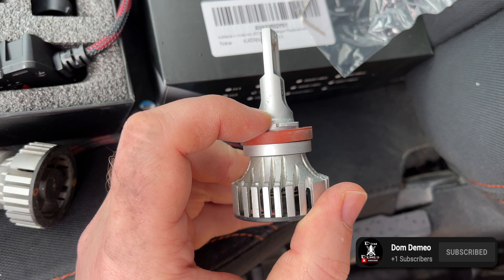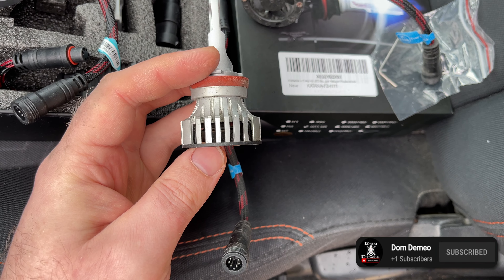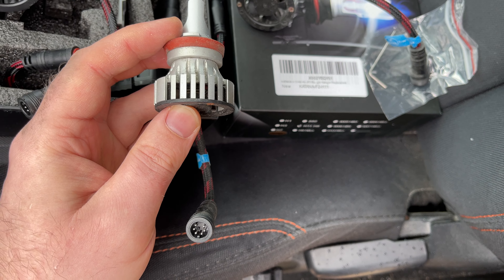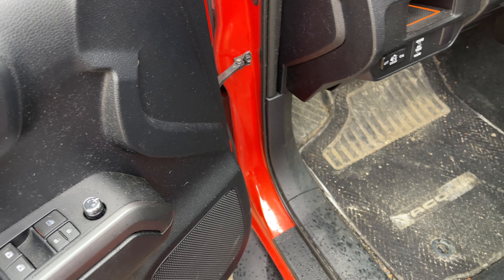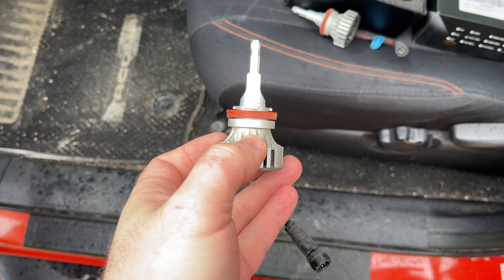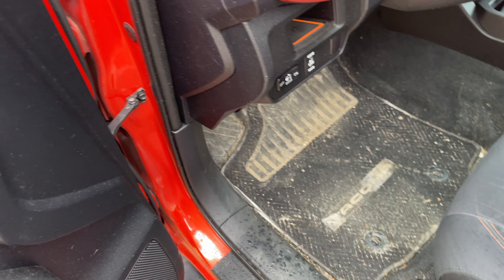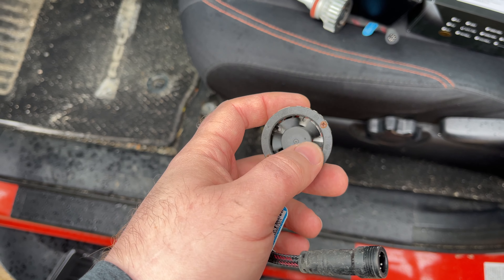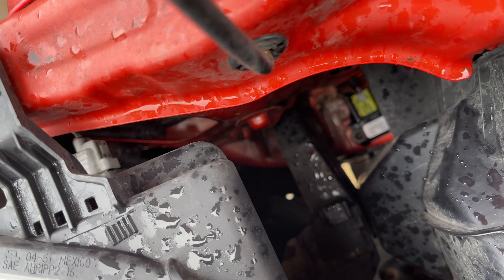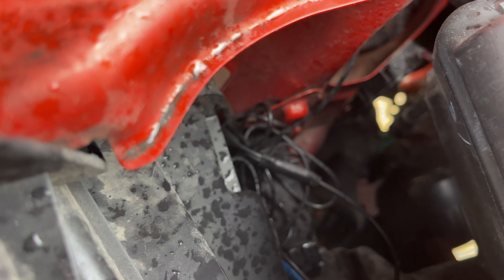These are the two headlights I took out of both the driver's side and passenger side respectively. On the passenger side this is canted off to the right probably about 15 degrees from center, and on the driver's side a little bit less. Having these canted off to the side slightly allowed these to sit in my high beam housing perfectly flat. Now I'm going to pop out my bottom two fog lights, replace those with my old high beam bulbs, and install my new high beam bulbs. The driver's side fog light is perfectly in line with the LEDs after around two years nine months — bearing still good, spins freely, no issues. The passenger side issue is all because of that hole where mud and debris gets in more easily than the driver's side.